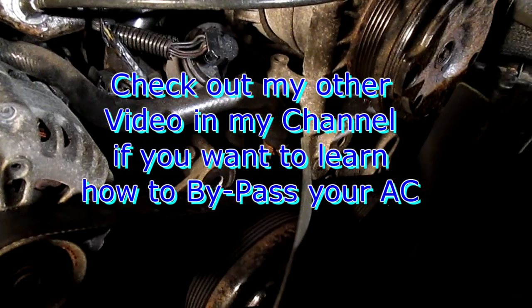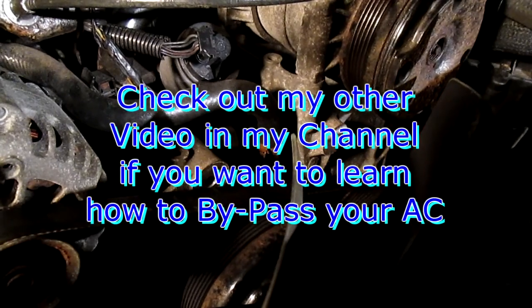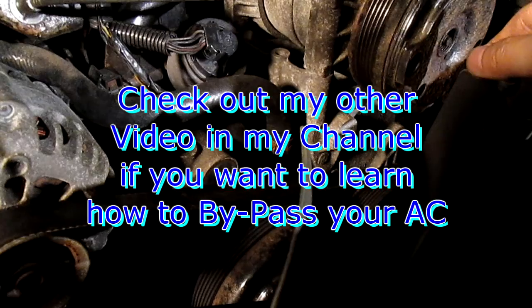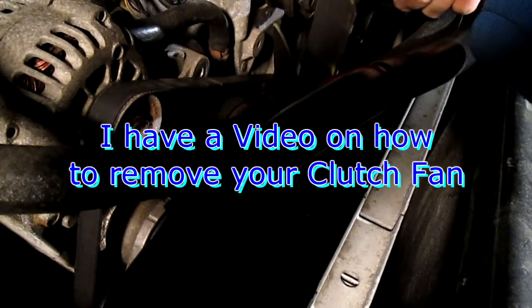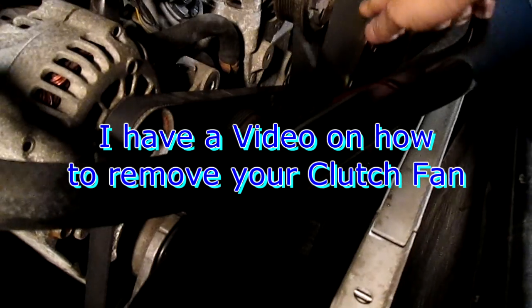When I did that, the engine cranked a lot better — it fired up right away, a lot faster. During those inspections it's a lot better now. I felt the fan here and there's no movement, and when the engine is on it's running hard. I think the clutch on that must have been seized, so it's been running at full load 24/7.